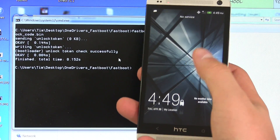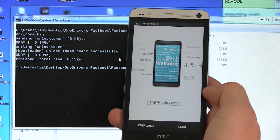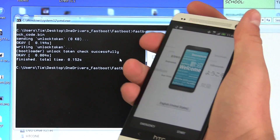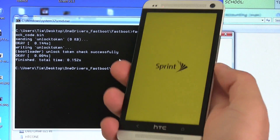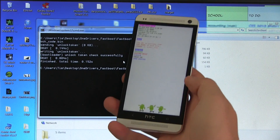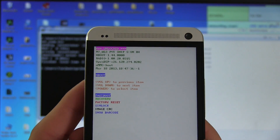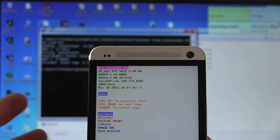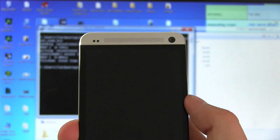And here we go — so it booted on up. You'll see 'Unlock the Device'. It does take us to that HTC start screen, but that should be it. Our bootloader is now unlocked. So we're ready to install a custom recovery and root our device. We can double check and make sure that our bootloader is unlocked — I'm just going to restart and go into that bootloader once again. Same process: press and hold the volume down button. Back into the bootloader — you can unplug your device now. Up at the top, it should say 'Unlocked'. There we have it — it does say 'Unlocked' at the top. It's still S-ON, but we are now unlocked. To get out of this screen, press 'Fastboot' again, hit Reboot, and press the power button — that's it.